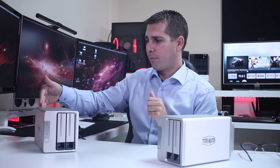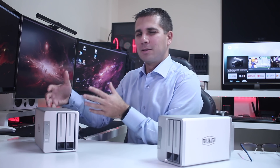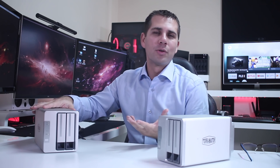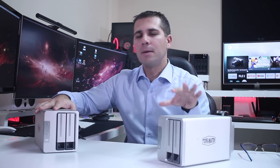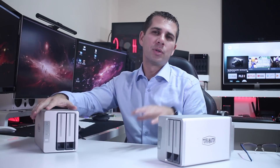There are also simpler backup options. One is backing up to a USB drive connected to the unit, and it has a great feature: scheduled backup. Some more expensive brands unfortunately don't offer scheduled backups when using an external USB drive. We can also back up from the USB to the NAS. Finally, there is the Time Machine backup option — for example, I can allocate 1TB of storage to back up all Mac computers on my network, set it up, and the NAS automatically handles the backups.